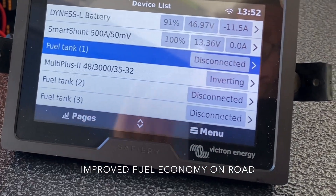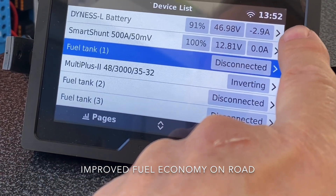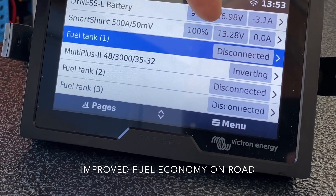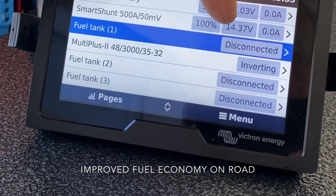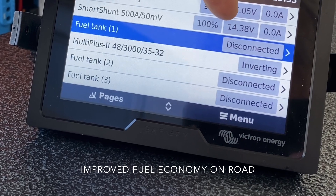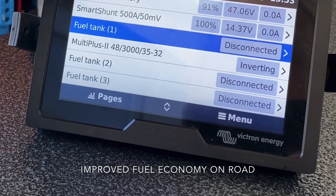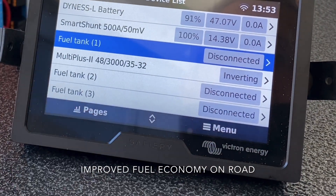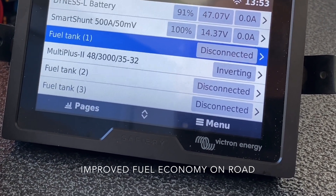Okay, start it up Andre. Now the battery's down to 12.7 volts — there's still 3 amps coming in, 12.86 volts here with the loads on: engine, power steering, everything else. The DC-to-DC won't come on until that reaches 14.5 volts. Right now at 14.37–14.38 volts there's no power going into the 48-volt battery, so driving around town in on-road mode there's no load on the DC-to-DC, making it fully Euro 6 compliant.